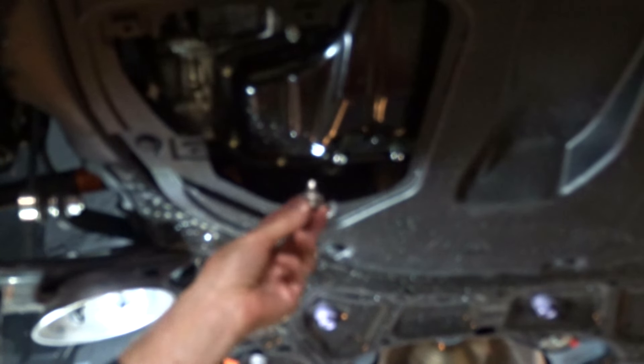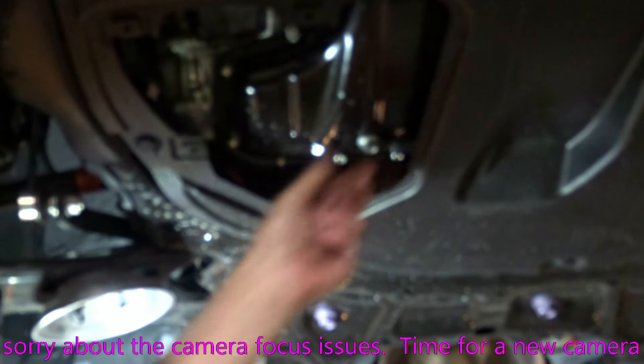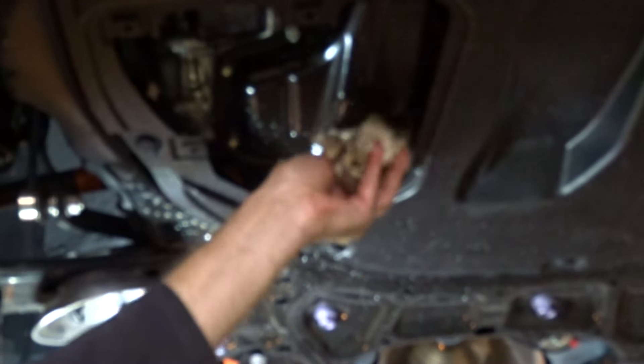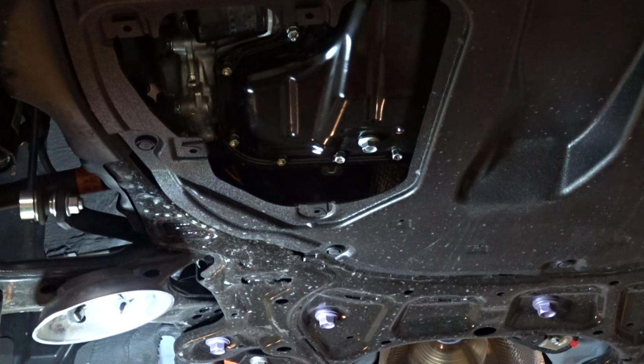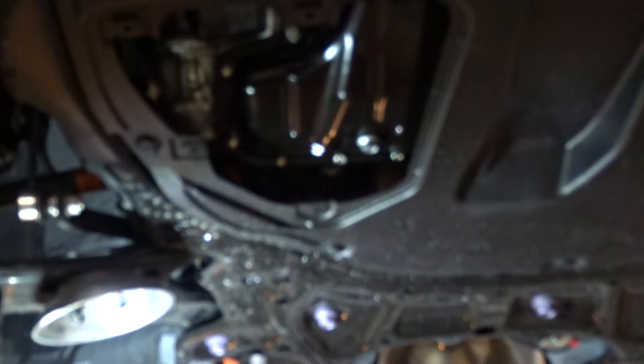Make sure your plug is clean. Install the new washer. Make sure the surface of the oil pan is clean and you can spin this in and then torque it to spec. Often I'll do these without actually using the torque wrench — the important thing is there's a certain feel where the crush washer begins to crush, but you don't squeeze it too tight. It's probably going to be somewhere around 30 foot-pounds of torque. I'll check the spec, but now it's not going to drip. Then I'm going to look for that old crush washer wherever it went.